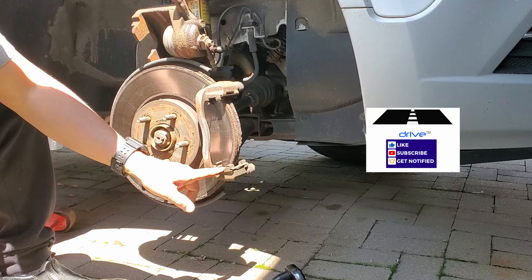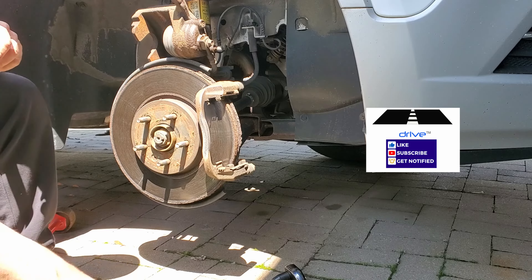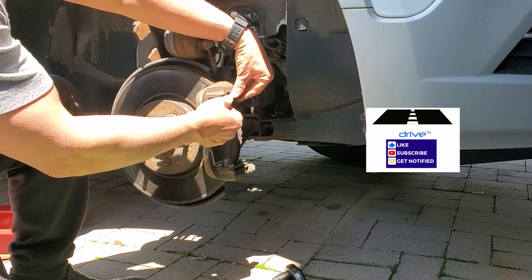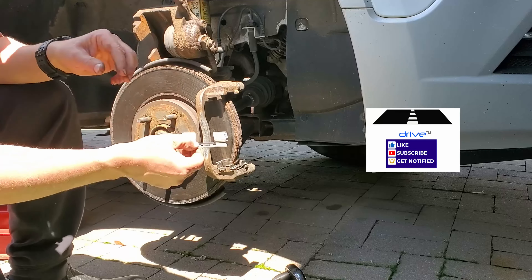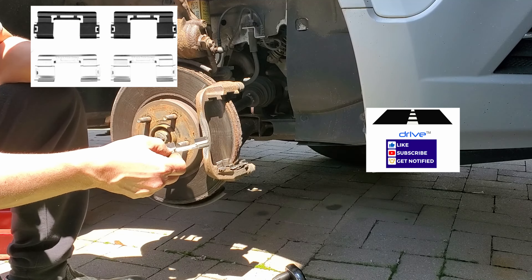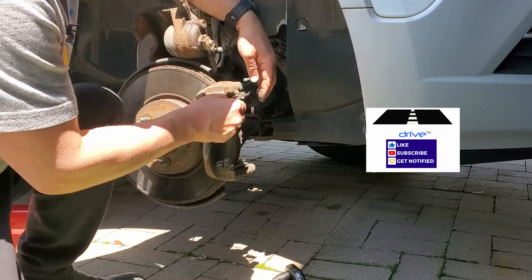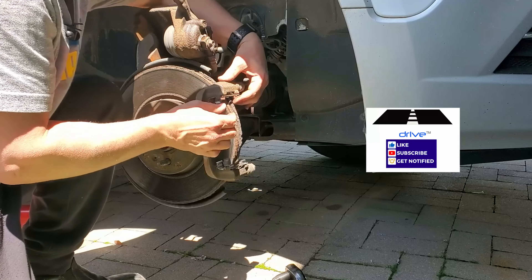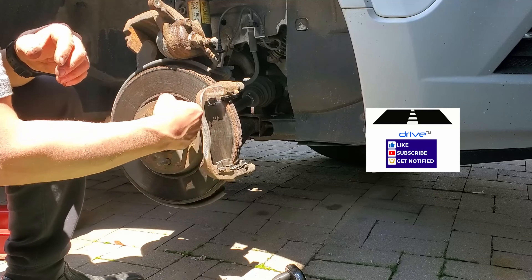The next step is to remove the two old clips and install new ones. I've already reinstalled the new clip at the bottom — I'm going to show you the top one. It's just a process of removing the old clip and installing the new one back in the same way. These are important because once you lubricate them they allow the pads to freely float, and as they wear they'll be able to move freely closer to the rotor. Once installed, they're ready to be lightly greased and then I can install the new pads.